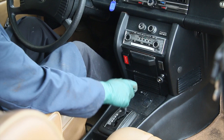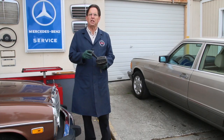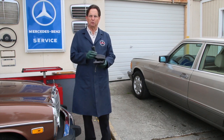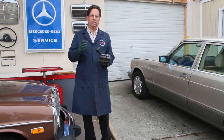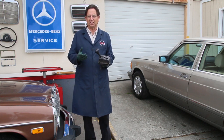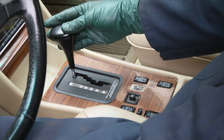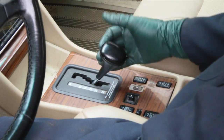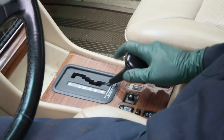This is an important safety issue. Here's a typical shifter assembly removed from some of these older models. This unit was used in the W114, W115, W116, the early W107, and the W123 models all the way up to about 1985. The W126 shifter looks a little different on top, but underneath the mechanism is still the same and it still uses those same bushings.